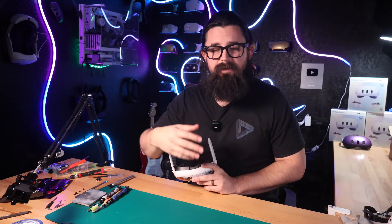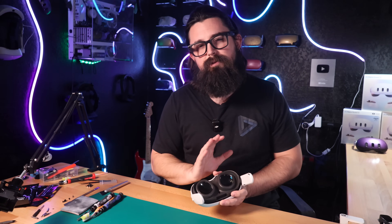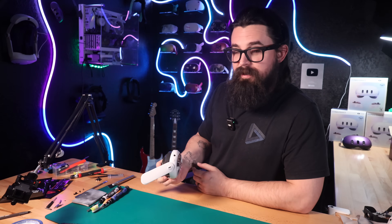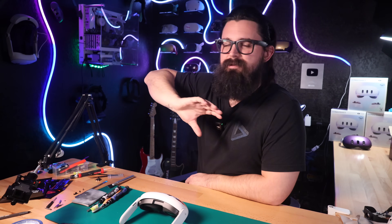It could also be an issue with the fan itself — a blockage, debris, it's super dirty, or just not cooling the headset properly for whatever reason. And then there's the external obstruction thing, which you see a lot with headsets that have stickers that close this vent up or prevent airflow. This headset doesn't look to be crazy dirty, so I don't think it's that. We've tested this headset quite a bit and haven't been able to get the issue to present the way it did in his original video. Most fan failures or obstructions don't result in the fan cycling up — they just do not work, or you'll hear a chirping or grinding inside the headset.